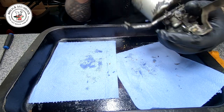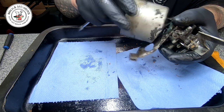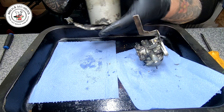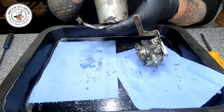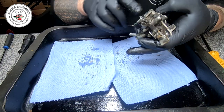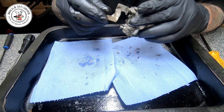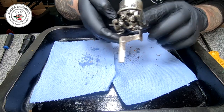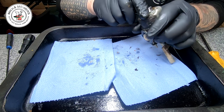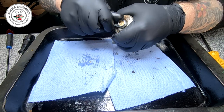That should start to drop out — that all comes off together, including the throttle plate. We'll keep it all together as it's going to be cleaned. There's a little gasket on there as well — we'll try and keep that in place. The choking and throttle all work as they should, so we're happy with that. Now I'm going to get underneath here on this carby and loosen that off, which is going to be no easy thing in itself.